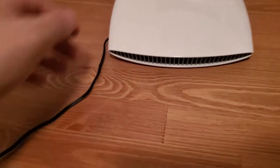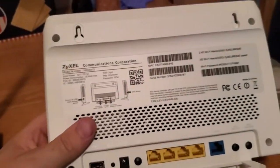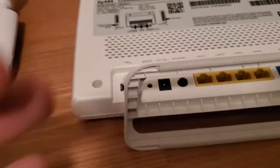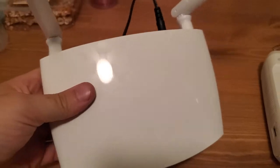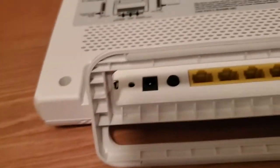I don't know how many routers Edimax makes — I'm not too familiar with them, but I'm sure they all look different. For the most part, normally routers have a reset button on the back, like this router over here — there's a little hole and the button is inside there. You just use a paper clip, find that hole, press the paper clip in, and push it down. There's a button in there, you just hold it down. So this router is a little different — it's got a button you actually press. But if you have an Edimax router and it's a different model, it might be different for you. Typically you have this little hole with a button inside it, and you hold it down for at least 15 seconds and wait for the lights to change. Then it'll reset and you'll have new default settings.